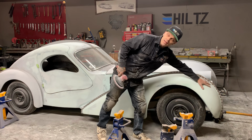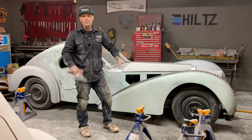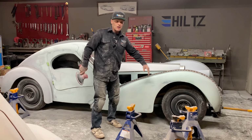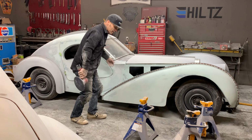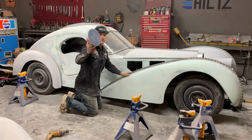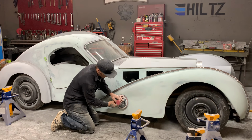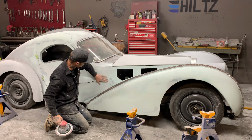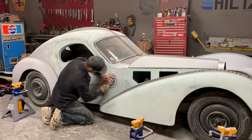When it's dry, or 3/4 dry, you can get it early if you want to. It's just sometimes when you get to the metal, it digs it off quick, and you don't want that either. So I just let it dry. 40 grit, 8-inch, and I would sand this like this. I would use this just like a block. I do not tip it. I do not lean it. If I'm doing these pieces right here on the door, when I mud it together, I sand it together.